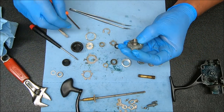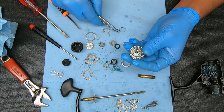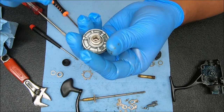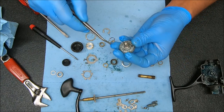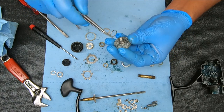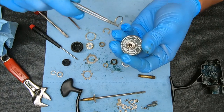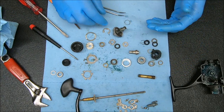The other piece is hooked into the main gear — there's another hole right there. The main thing about this one is that when you put this in, you want to make sure the long hole goes into the main gear and you want that spring recessed inside that channel that you'll see when you look at yours.